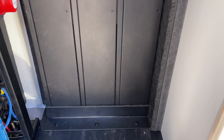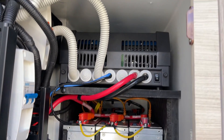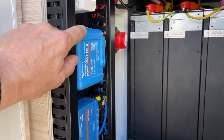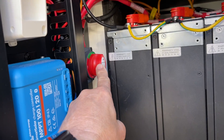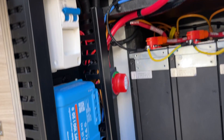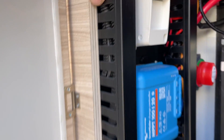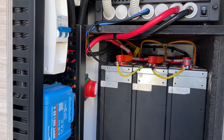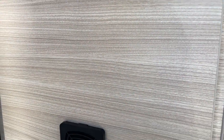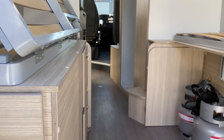We filled in the floor and then we've got our three 200 amp hour lithium batteries. You can see the CAN cables up on top of that. There's a 3000 watt inverter on top. The solar breaker is just here for the roof solar controller and the turbo down here. The main isolator is here, and up here is a 48 volt fan. We've got our own proprietary temperature system — a temp sensor — that will come on automatically, running independently so we're not using the software driven off the batteries. This means the compartment can be totally closed, with fresh air coming in through the vent at the bottom and going out into the cavity behind.